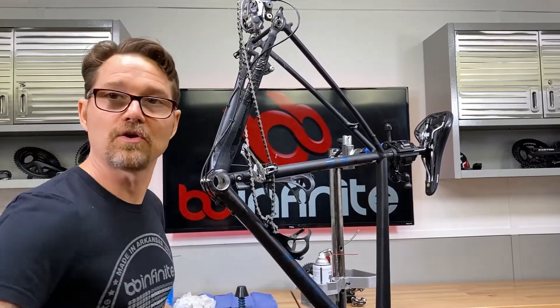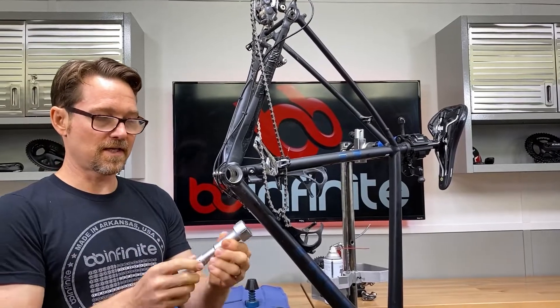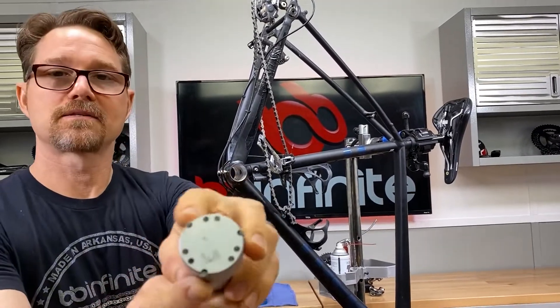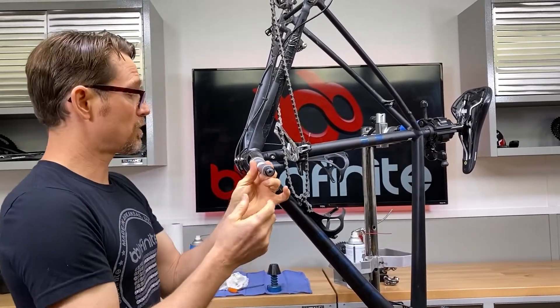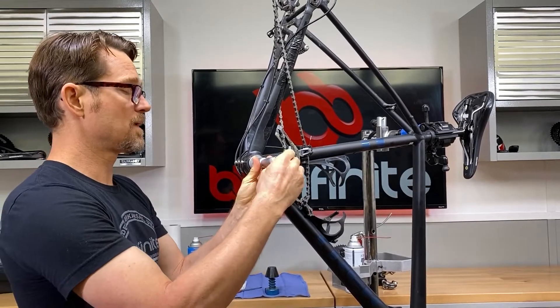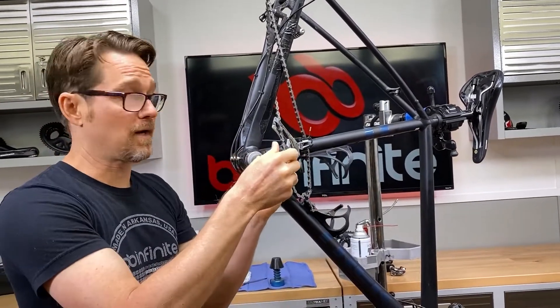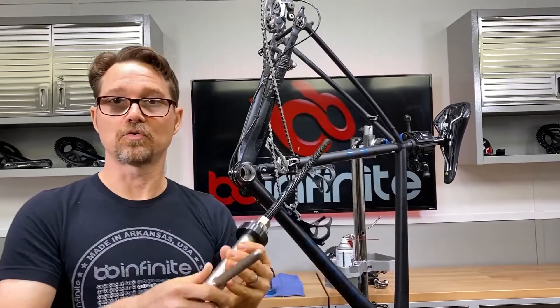You will be measuring the dirt and you will throw off your measurement. What I'm going to use here is an inside mic — it measures in three spots, so it is very accurate. This is a nice quality tool, and I'm just going to chuck it up in here and read it. I've already done this, which is why I know this bike needs to be reamed. We are going to be using this to open this hole up very shortly.